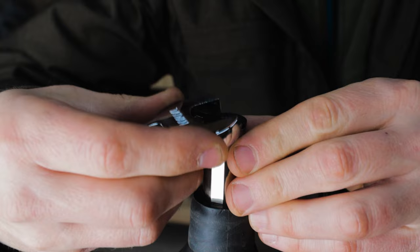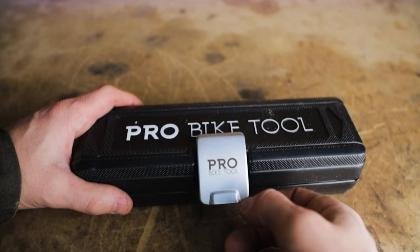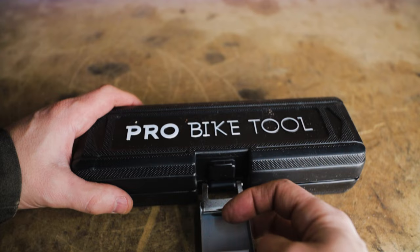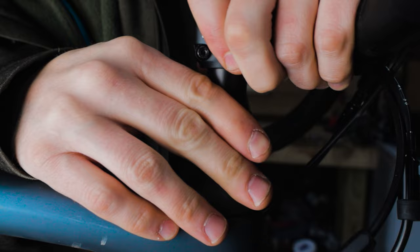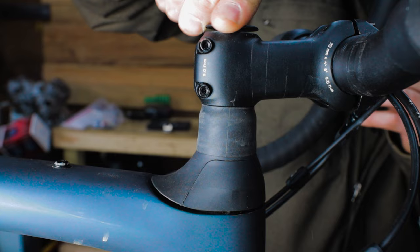Reinstall the cartridge cap and torque it to 6.2 Newton meters. To do this you'll need a crow's foot like the one shown here — if you don't have one, just tighten the cap until it feels snug, though I highly recommend getting a crow's foot and a torque wrench. Check the description below; I have links to most of the tools I use. If all you want to do is replace the booster spring, put the assembled handlebars and stem back on, hand-tighten the top cap, and firmly tighten the stem bolts to 5 Newton meters.